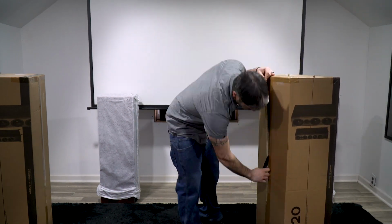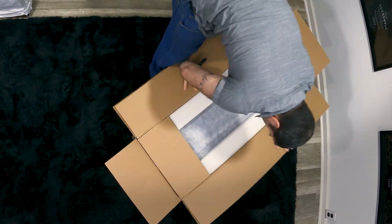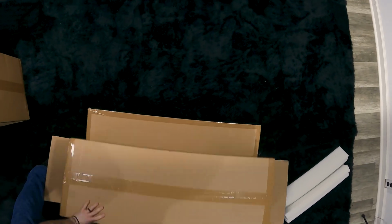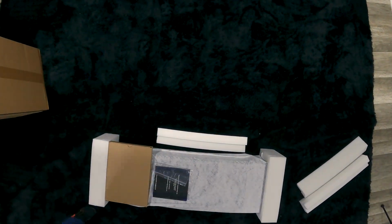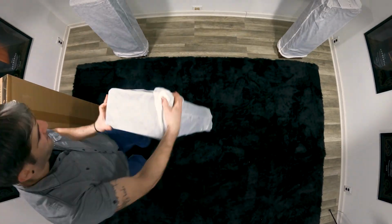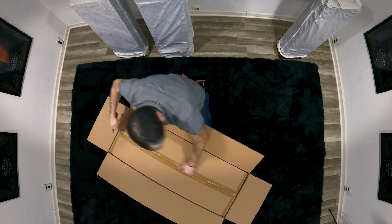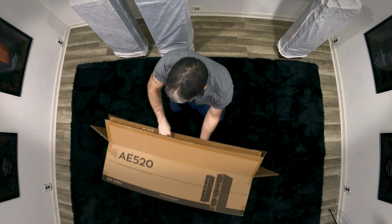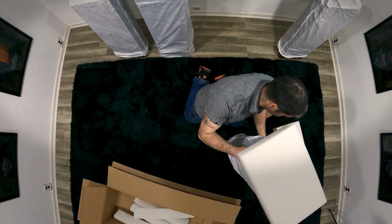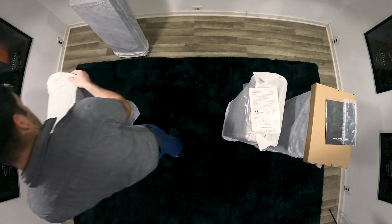Now, as for the 520, the woofers are 125mm carbon fiber cones. The tweeters are 25mm carbon fiber domes. Bandwidth is from 30 Hz to 28 kHz. Sensitivity is at 90 dB. Peak SPL is 113 dB. Power handling is 300 watts. The crossover frequencies are 373 Hz and 2.8 kHz. Dimensions are 1130 by 185 by 320, which is 44.48 by 7.28 by 12.59. The weight is 30 kilograms.